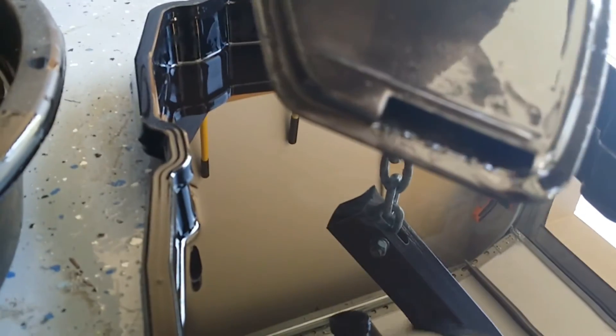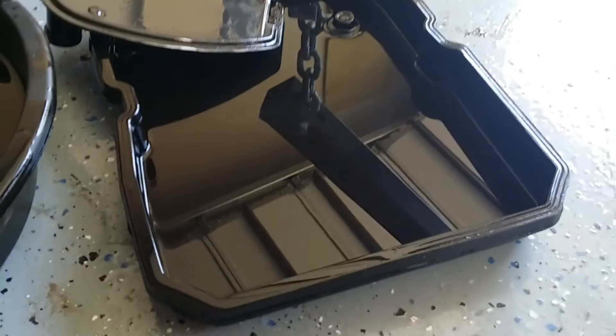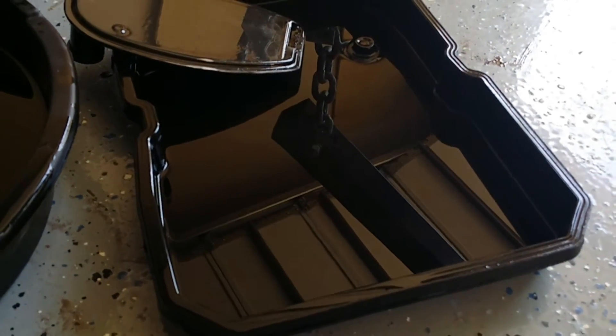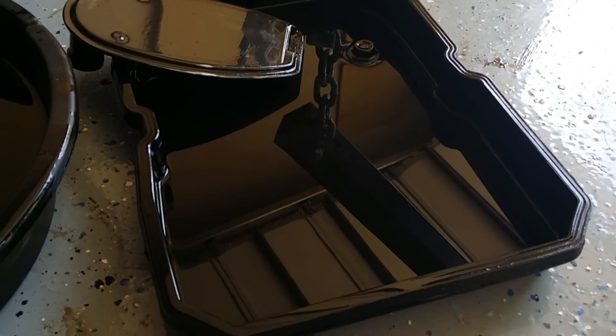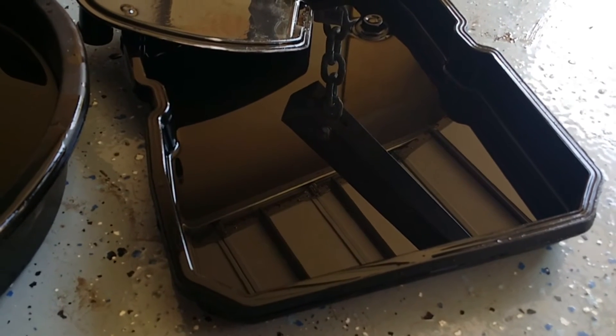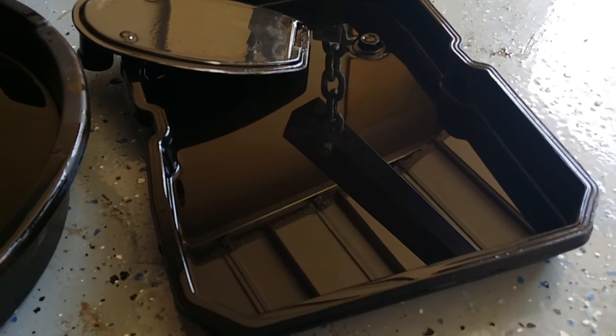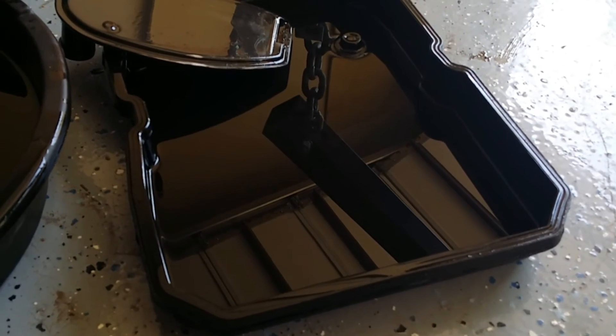The filter doesn't look too healthy either — it's a little thick in there. Fortunately, there are no metal shavings. You can almost see a glare, like oil floating on water, so it's possible I got some water in there. Maybe the O-ring on the dipstick tube is leaking, so when I clean the engine bay, maybe a little water got into the pan.